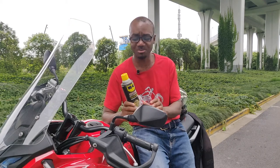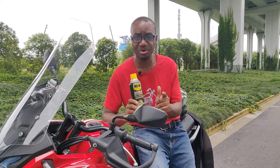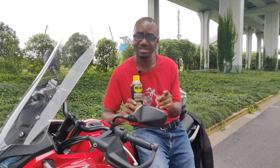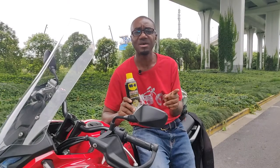I mentioned I also use this product to clean the sides of the rim and tire, but you do not want it anywhere near the contact patch of the tire — the part that touches the ground — because it becomes very slippery and can be extremely dangerous when riding. Avoid having oil or WD-40 on the contact patch of your tire at all costs. That said, WD-40 is great for cleaning your rims and making them shine, but again, do not spray directly onto the rim — spray it onto a cloth first.